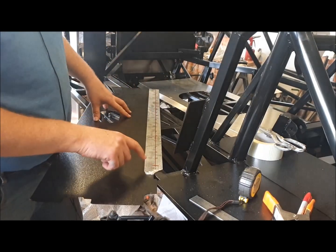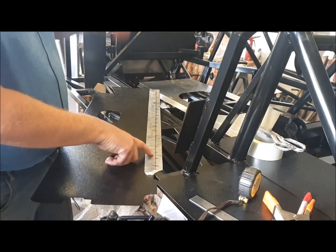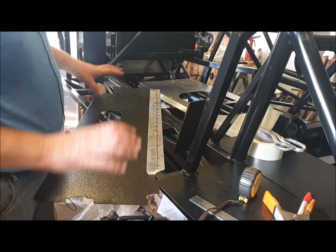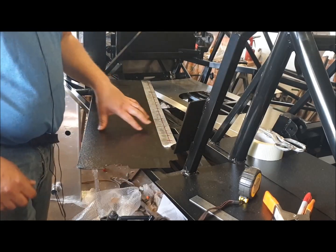Now what I'm going to do is drill out these holes — a four millimetre hole at each mark. Then I should transfer that to the chassis when I've put the panel on in the position I'm happy with and clamped it. So I'll transfer those holes over first, then come back and carry on with them.